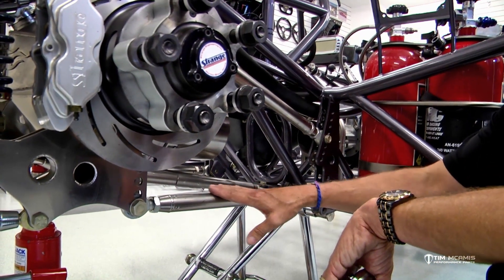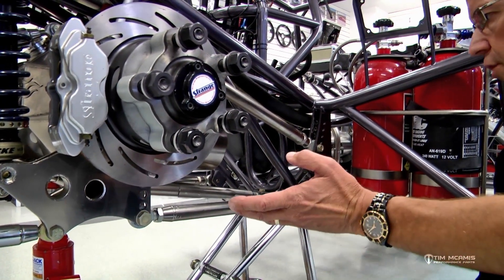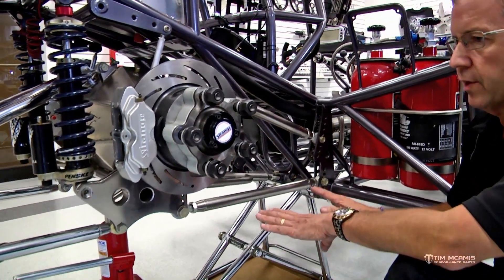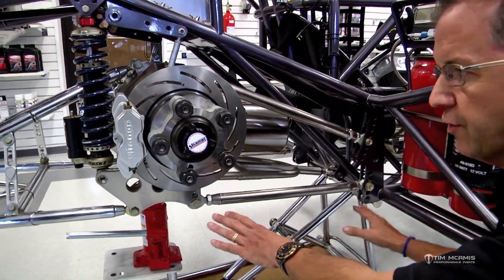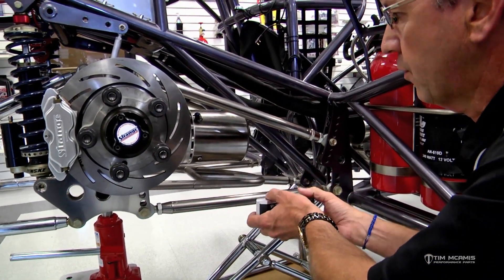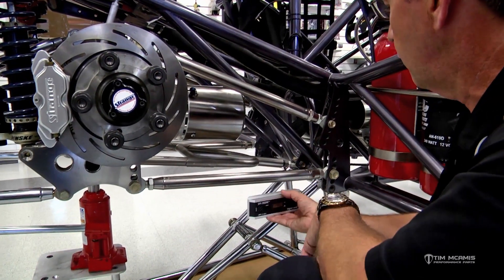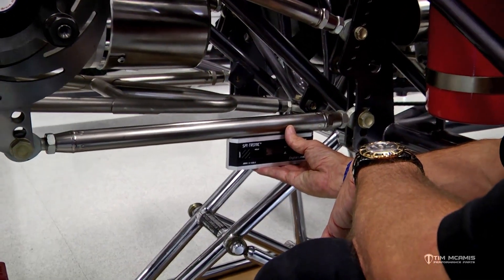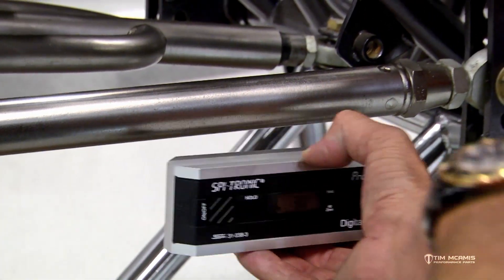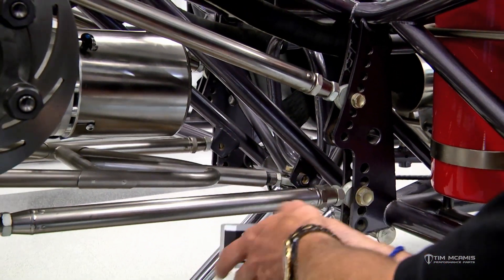Let's say we're going to have this bar at zero. I want to be at ride height when I do this — I've got the car jacked up with the rear end in the ride height position, simulating how it would be setting on the ground. Ideally, you want to check this with the car on the ground, driver in it, race ready, tire pressure right. In another video I talked about this SPI digital protractor. You can simply slide under the car and I talked about this V-groove for setting on a tube. I can put this on the tube here, press the hold button to lock it in, bring it out, and see that it reads 3 degrees — meaning I need to tip this bar down to 0.